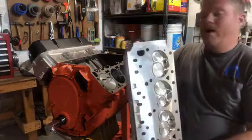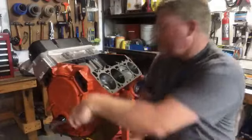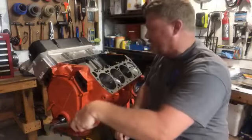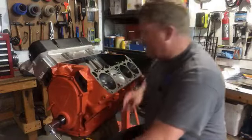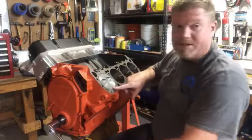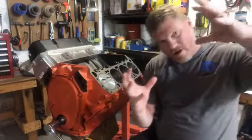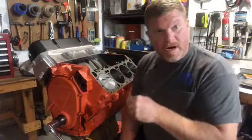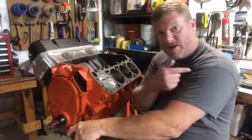When that explosion happens, it helps push this piston all the way down in the length of its stroke. And now it's on its way back up. I'm manually torquing this. As that piston comes up, that's the exhaust. The explosion blew it down, and now it's pushing all that back out. Where's it going to go? It's going to go out the exhaust valve. The exhaust valve opens up at the same time, and it squeezes all that exhaust out.